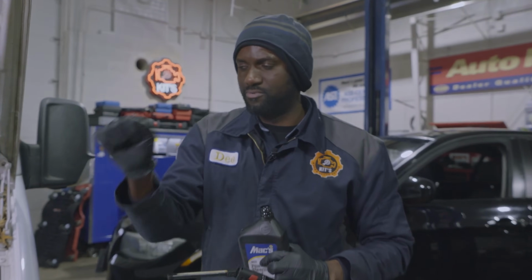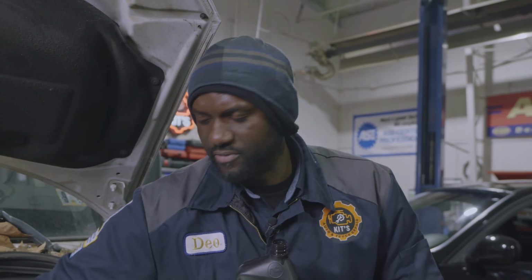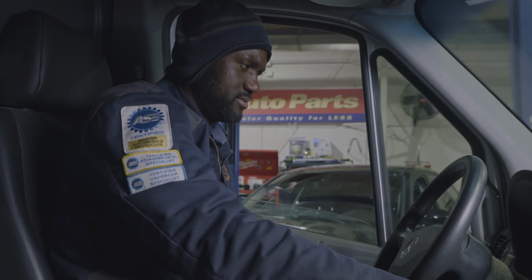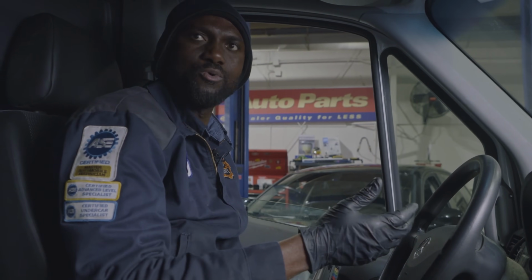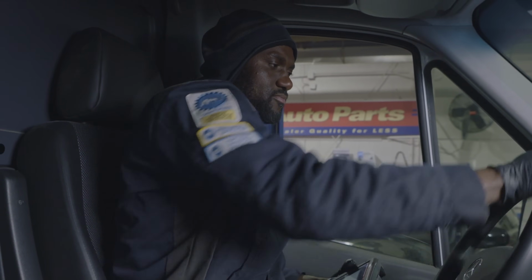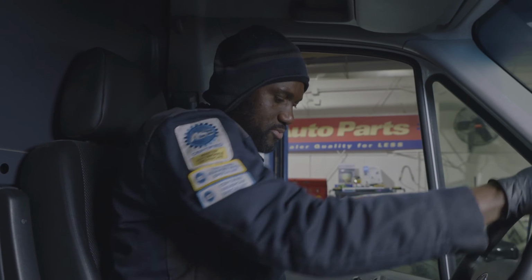To bleed the system, you have to turn the steering wheel left and right. So it's got quiet now. And then I'm gonna observe it to see if there's a leak somewhere. Okay, so I'll put the cap back on. Let's go back in the vehicle so we can scan the engine computer. It's a lot quieter now. It's still making noise a little bit, but this is a lot better than the way it was.